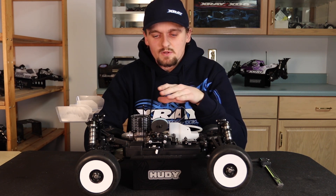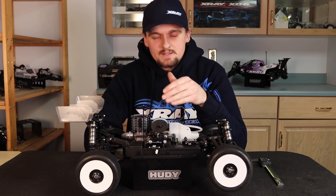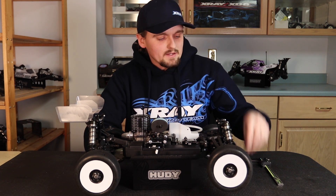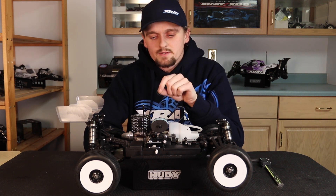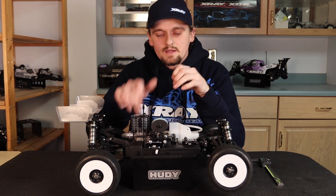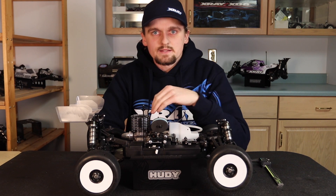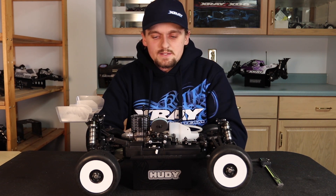Then you won't have as many issues and your car will run like it should — your carburetor is going to open and shut fast. I even put a little rubber band around the carburetor to pull it shut a little bit faster, to help that linkage spring back so when I go over a jump it comes down to idle instantly. That way I can time the jump properly, control the car in the air, and it just makes the car easier to drive.